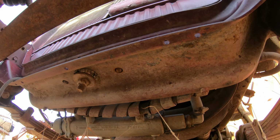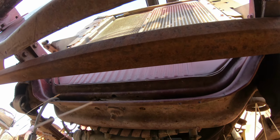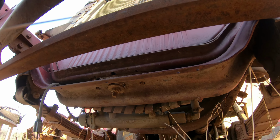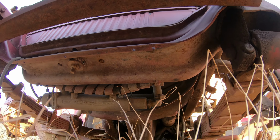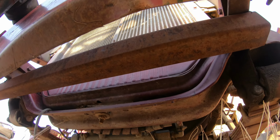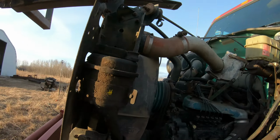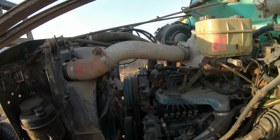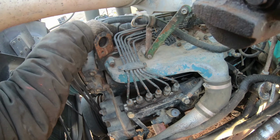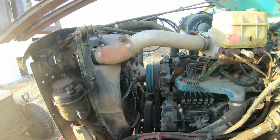Wow, look at that. This truck has a lot of good stuff on it. Inline block heater, or inline radiator coolant heater. It's got a big heating element in there. That doesn't look too old either. Probably still works great. So that's great, because this truck doesn't have glow plugs in it. It's all just high compression. So in the winter time I'm going to plug it in.